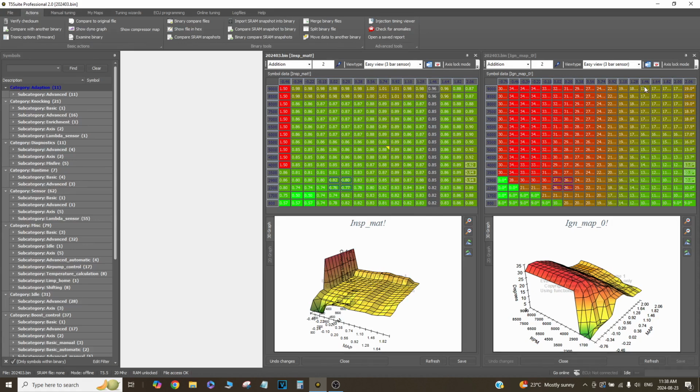And then the ignition timing isn't too crazy there as well, because on lower boost, that's what I use in second gear. If you didn't know, I have a switch behind the steering wheel that goes between low and high boost. So low is 1.5 bar ish, so 21 pounds or 22 and a bit. And then high boost is 32 ish, 31 ish. And then I got the overboost button on the front of the wheel that just makes the boost infinite because it's aligned to the top of the gate, but it's a slow leak into the gate, so the boost doesn't just skyrocket.